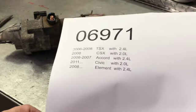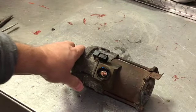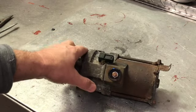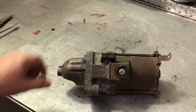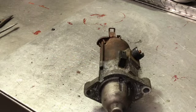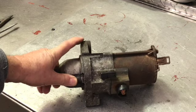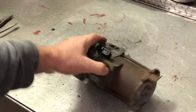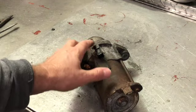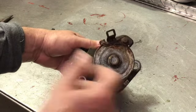These applications are guidelines. It's not really severely important that your car matches up with that application data. All these Mitsubishi starters are similar and they're all going to take very similar kits. You can see the back here is a little bit thicker than the bottom one, and the ignition switch plugs into a rectangular fitting with the clip on the top, and there's a harness bracket in that configuration.